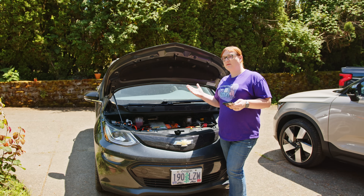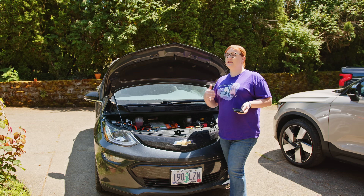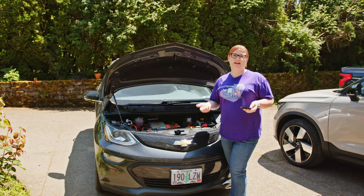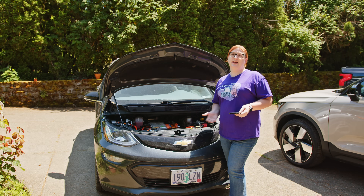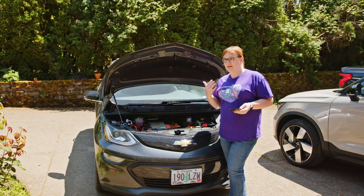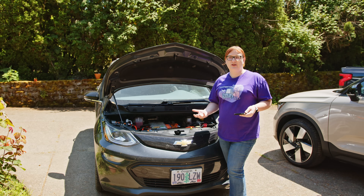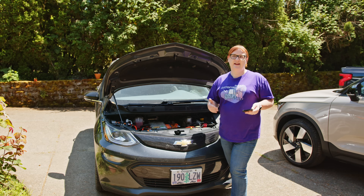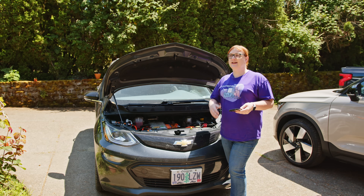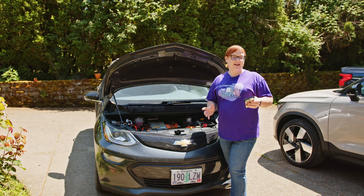This car also has a lithium iron phosphate battery. Lithium iron phosphate is a lot lighter than lead acid batteries and perfectly suited for life in an EV. As we've noted in previous videos, heavy lead acid batteries — while they have great capacity for cranking over an internal combustion engine — don't really like life in EVs. They're not designed for EV use, and even a deep cycle battery isn't really suited for the purpose of a 12-volt starter battery in an EV.